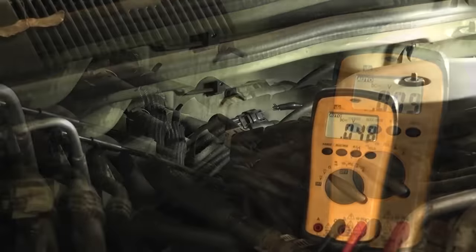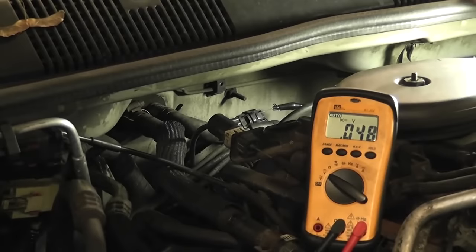We're going to focus on the signal circuit next. First thing, we're going to show what this looks like cranking. What we saw was around 400 to 600 millivolts. The thing about this sensor is this is a zero to five volt square wave. I'm showing you the limitations of the voltmeter here. When you're looking at an on-off signal, what it's going to read is going to be unique to the characteristics of that signal. If it's low longer than it is high, it's going to have a lower average. If it's high longer than it is low, it's going to have a higher average. This is a zero to five volt square wave with an average reading of around 500 millivolts cranking.